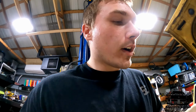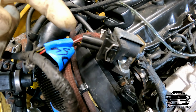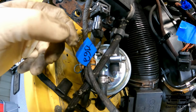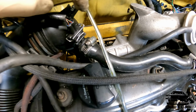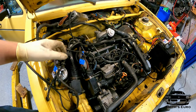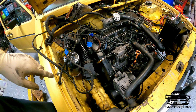And I was looking into wiring harness. So in case you guys get here, the N75 valve, the wire is red and blue. And then the EGR, which most people delete, this is brown and white. And the PCV heater up here is red and green. In case you get in this predicament, that'll help you out.